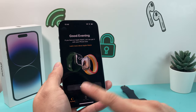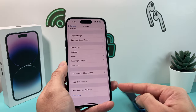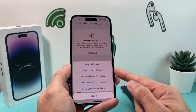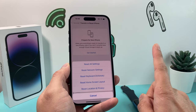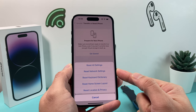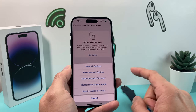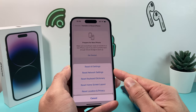If you're still having an issue, the next thing to do on your iPhone is go to Settings, then General, then scroll all the way down to Transfer or Reset iPhone, click on that, then Reset, and select Reset Network Settings — the second option. This will not delete your data like photos, videos, or apps. It will only delete saved Wi-Fi passwords, any VPN settings, or network profiles you've set up.